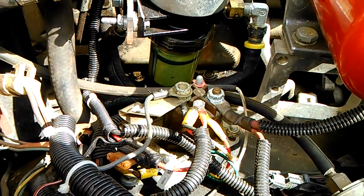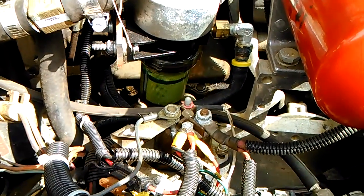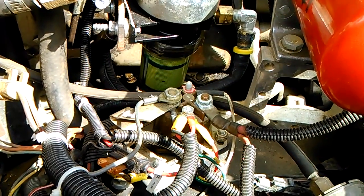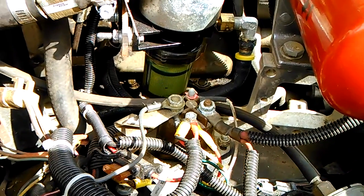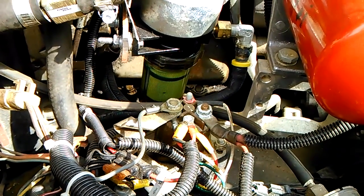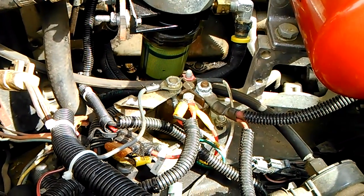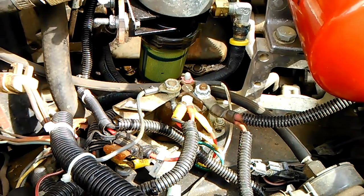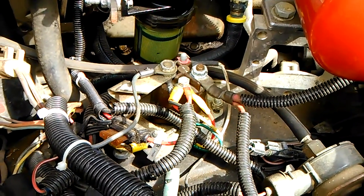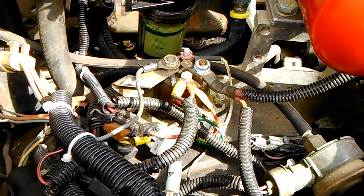And if you have a manual, like a push button controller, it doesn't take very long, a few seconds. I installed the automatic controller because I was having problems with frying plugs, even at only 10 seconds at a time. I was still having trouble with my plugs getting hot. Of course, it was around the same time period I was dealing with the AutoLites, so I'm pretty sure it wasn't the manual button itself, but you still want to be careful. You don't want to fry your glow plugs even with a push button with Motorcrafts. Anyway, hopefully that helps and kind of guides you in the right direction if you're looking to do a tune-up right before the cold weather hits. All right.